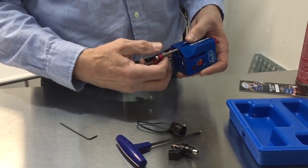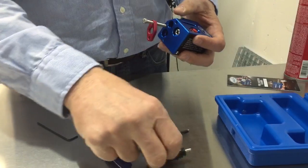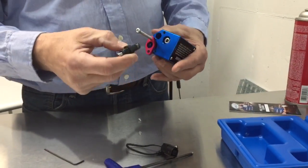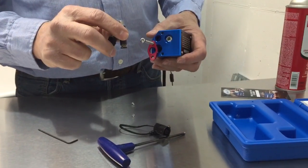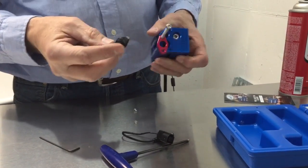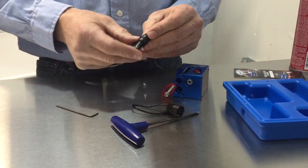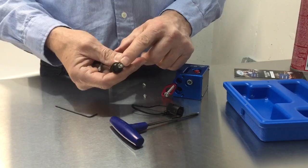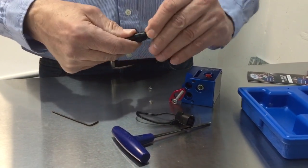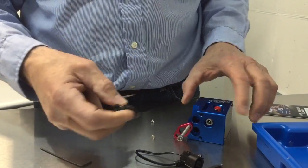I usually just leave one of them backed out most of the way and take the other one completely out. And then put the injector in. And you have to do it both directions. Let's see here. So when you first put it in, it tells you in the instructions to start off by putting this part of the injector in first. This is the spray bar, and there's a big rubber flat washer here. Make sure you've got that in place.